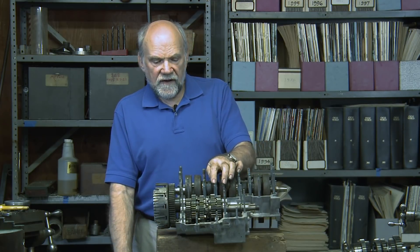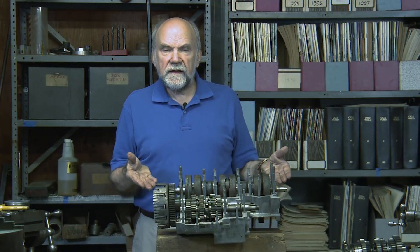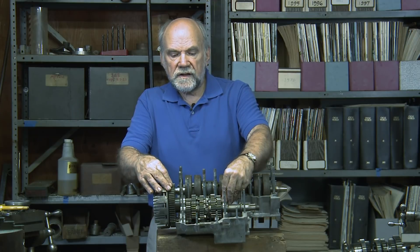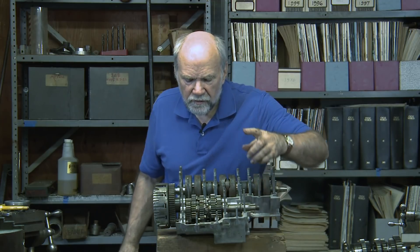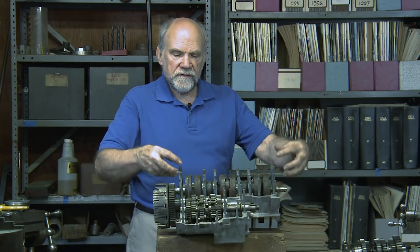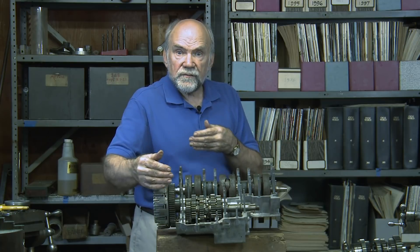Here is a Kawasaki 500 engine built the old way. We have everything lying in an open clamshell, and the lower crankcase half has been removed. Here's the crankshaft, here's the gearbox input shaft or countershaft, and this is the output shaft, which would have the drive sprocket driving the rear wheel. Behind this is the kickstart shaft. By lining everything up in a single clamshell plane, it makes the engine very easy to assemble — put in the crank, the countershaft, the output shaft, and the kickstarter shaft.